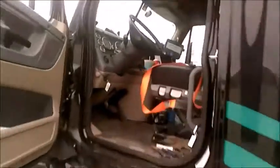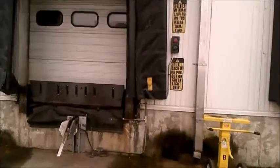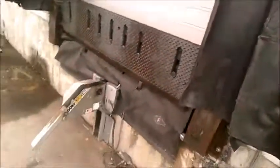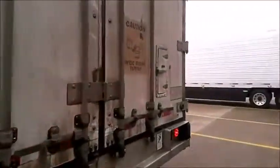Should I slide the tandems back? Yes, always a good idea. Just turn them off. See that yellow line on the ground — does it match with the yellow line on that bumper? It doesn't match with the yellow line up here. See how far off they are — about a foot off. But we want this rubber thing right here to match up with the steel thing right here, bumper bump up against that. So it appears that yellow line isn't the true mark we're looking for — this is. So my bumper is directly gonna be lined up in there. I like it, so I'm gonna stay where I'm at. Tires are inside the yellow, pretty good — that's what we want.